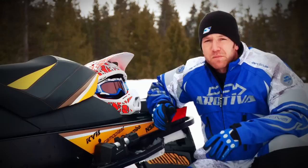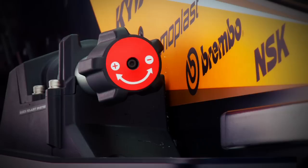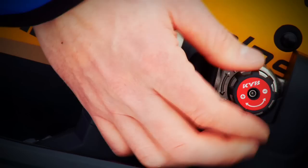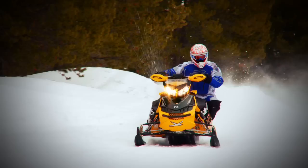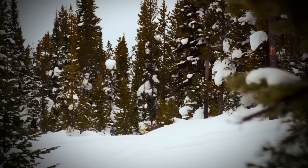This new suspension is even more impressive featuring optional external adjustment of the rear-arm shock, compression dampening and spring preload using these ultra-trick dial adjust knobs. Old school clicker knobs get jammed with snow while riding and can be hard to find or work without on the trail. These new external adjusters mean you can tune your suspension to the current riding condition without tools in seconds. I found the ability to tailor my ride incredible. We all know every trail is not created or groomed equal. When you come upon a rough-rutted trail, a 30-second adjustment will alter your sled's performance, completely smoothing out the worst sections you could possibly imagine. A compression clicker isn't exactly a breakthrough, but an external hydraulic preload adjuster is, and it allows you to take your ride from ultra-plush to ditch-banger in seconds.